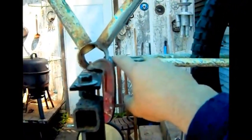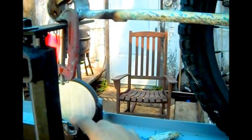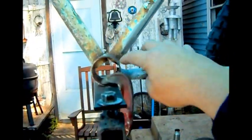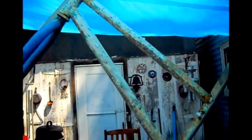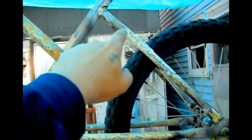What you do is, when you get this all cleaned up and ready, you get your pipe on here before you squeeze it, and you make sure to find your measurement — what you need to cut off. I cut this much off. You heat it up here. I have a jig built here, with the sprocket pieces on it, which I showed in another video. You heat it up and you're going to be bending the frame back. I go about 55 degrees.